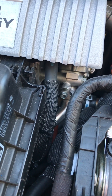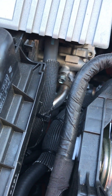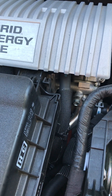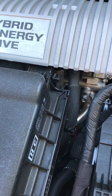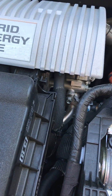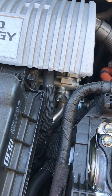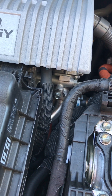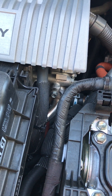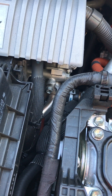If you've worked on these you'll get this instantly. The main problem with these cars is that the PCV valve is mounted on the side of the engine block horizontally, which is not a good idea. They fill up with oil and spit that oil back up and around through a very short u-shaped pipe.